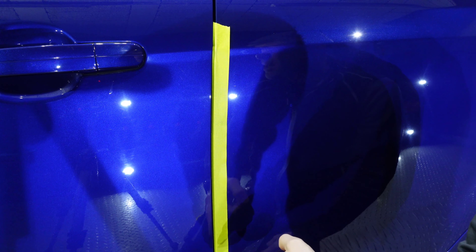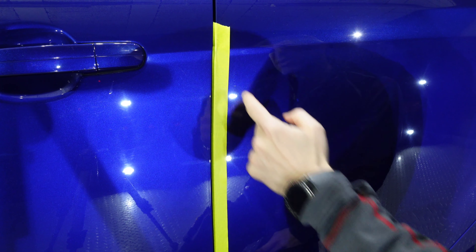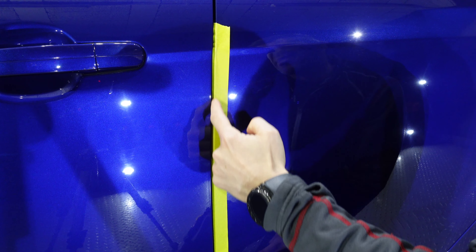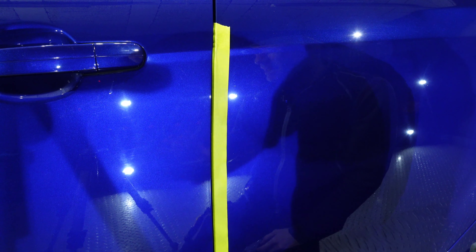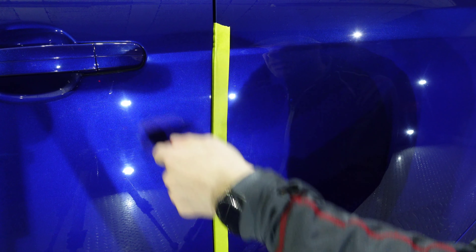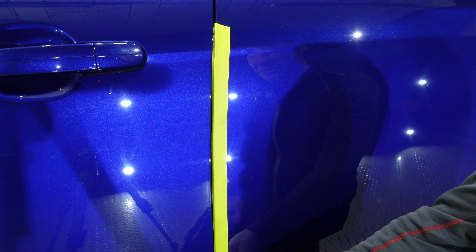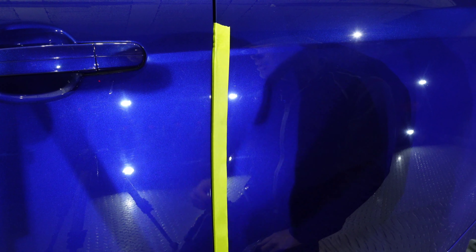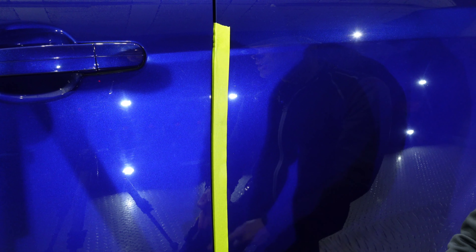But it's a waste of tape, a waste of time, a waste of money, and it's potentially dangerous. If you've got a smart repair or a loose piece of clear coat on this edge and you pull that tape off — I have literally seen this done, it was in a training session — you pull that piece of tape off and clear coat, maybe even color, comes off with it. Waste of time, money, resources, and potentially dangerous.